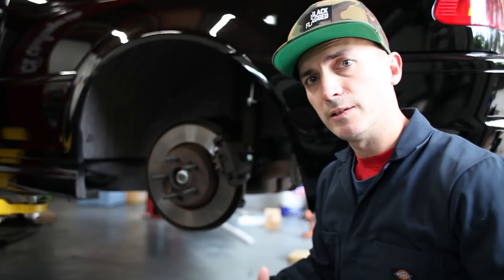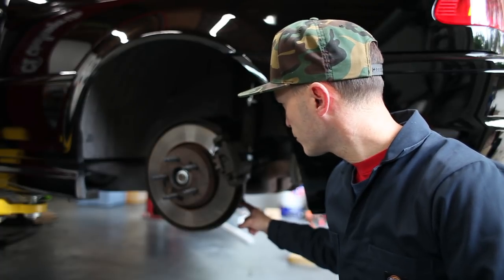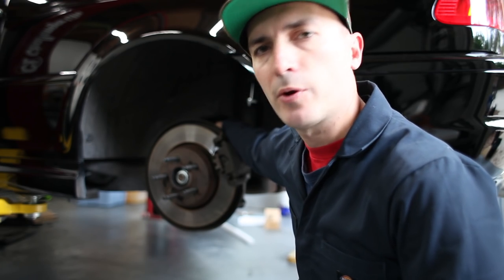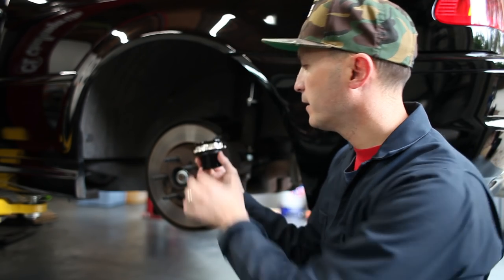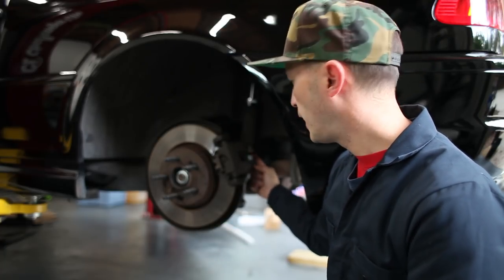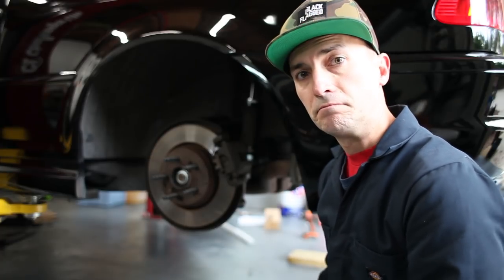The way this is going to work, as I understand it, is we're going to take off this lower shock mount here, be able to drop the suspension, pull out the spring, put this between the spring and the body, adjust the preload, and then adjust the shock and bolt it back on. Check the height.